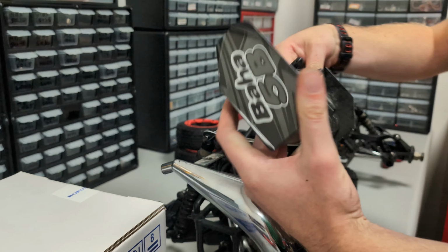Keep that aside. So you can just take a flathead screwdriver in these little notches right here on the gear, and you just put it in and twist, and then you'll be able to pry this off gently. Okay. So then the gear just slides off with the E-clip. There's also a spacer in here. This spacer is really important. You don't want to lose this spacer. So there's two bolts on either side of the pinion gear that we're going to remove.